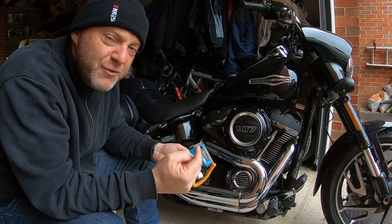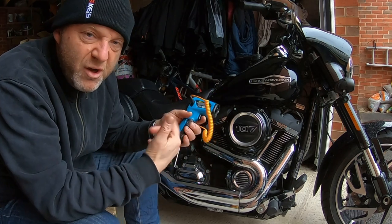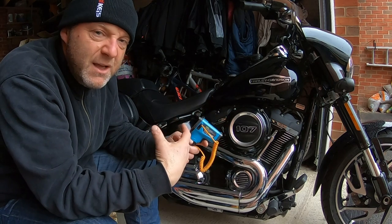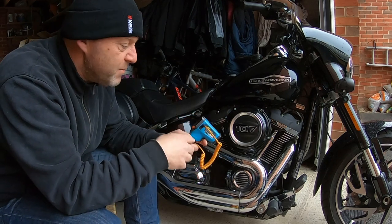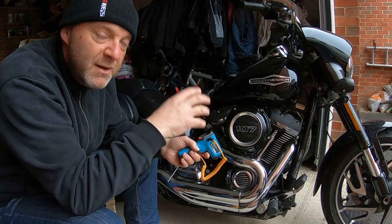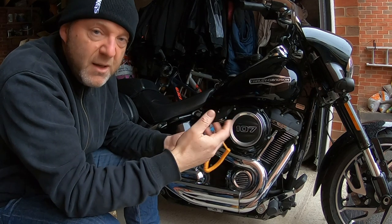So I don't think that reading is right at all. It takes about 15 minutes for the engine to reach that operating temperature — about 93 degrees Celsius, which is 199.3 degrees Fahrenheit. Mine had got up to 100. You could argue that this isn't exactly the most accurate, and I'll take that on board. As I said, I couldn't really get an accurate oil temperature reading there. Lots of people do send me emails about engine temperatures and oil temperature readings, and I think this way isn't the best way to do it. But I thought it might give you a better idea of how long it takes for the engine to heat up to that operating temperature. If you go off the cylinder head temperature of 93 degrees Celsius, 199.3 Fahrenheit, that's basically where you want your engine oil to be operating before you start doing any of your service items.